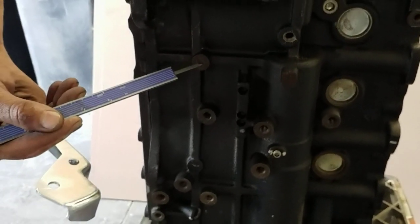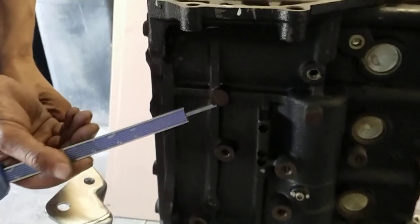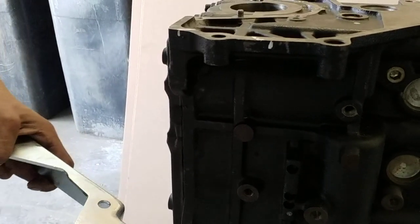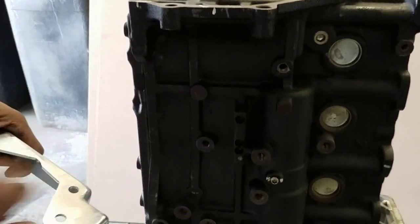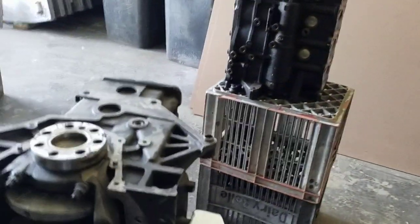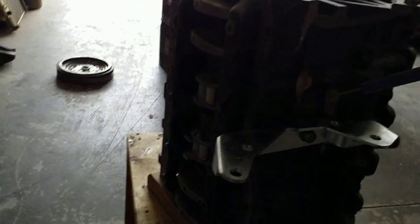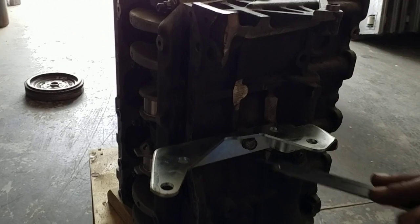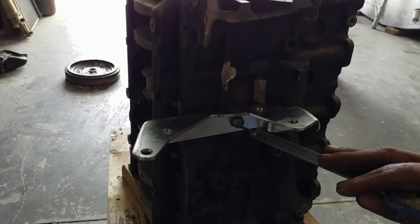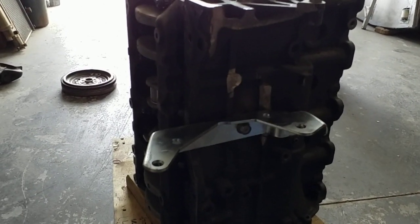This little bung over here — I would just remove that. There's about four millimeters of material standing proud there, just cut off that four millimeters. Once you've got the top cut away, then you want to mount the bracket. So that's the bracket mounted with the clearance behind. I ground it all the way up to that point and removed that little bung as well. So mount the transfer bracket, make sure it's got clearance behind, and bolt up the bracket. That's your transfer bracket done.